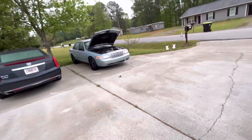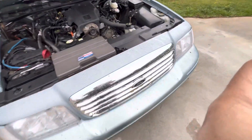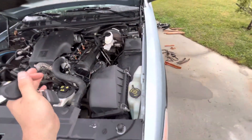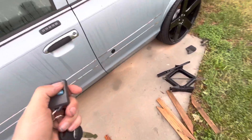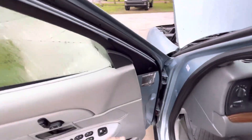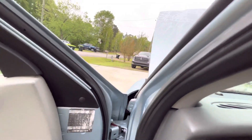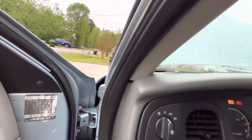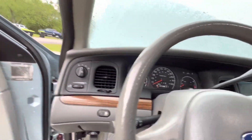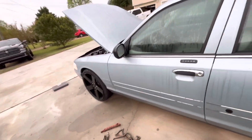This car should be fine — it does run, but it sounds like complete shit. I'll start it for just a second so you can hear how loud it gets. This car's got good compression so the motor is somewhat healthy — I don't know the exact compression numbers — but it's going to be loud because of the spark plug hole being open. The tube being broken for the EGR doesn't help either. I've still got to do the hinge pins and all that stuff for this car also. Fair warning — if you're using headphones, turn it down because it's going to be loud. Of course it threw a check engine light because it's running on only seven cylinders, so it threw a misfire code immediately.